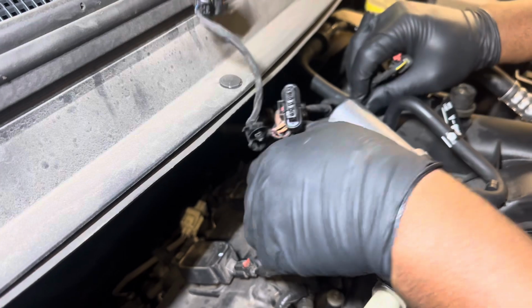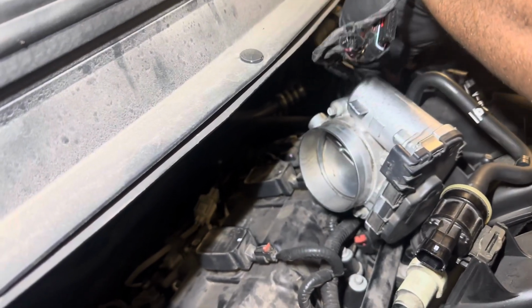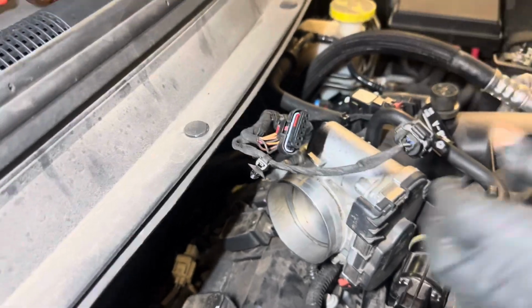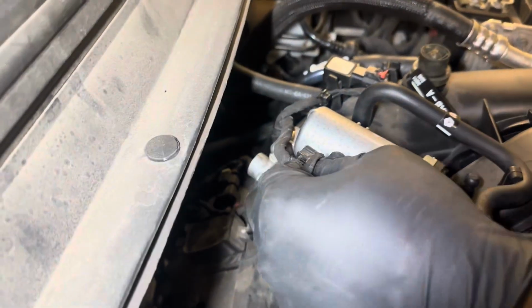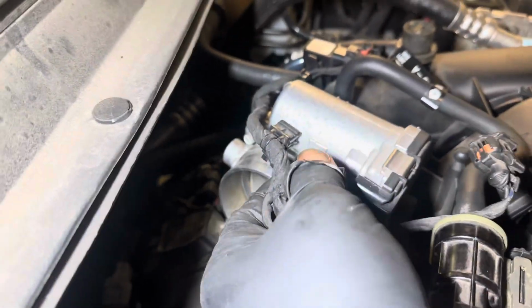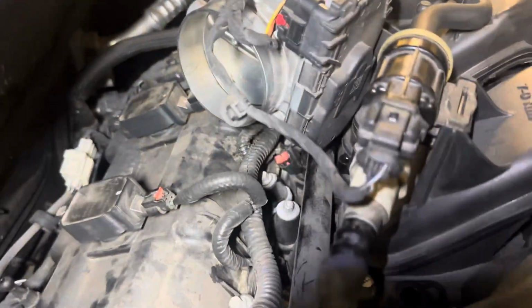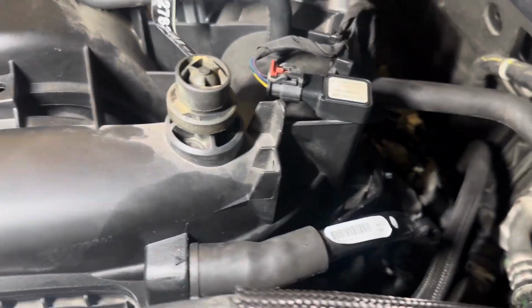Okay, the wire harness that you took off for your throttle body, we're gonna show you where everything clips in. So your first black one goes there. Then you have the holder clip go there, sensor clip there, and then you're left with that last one that goes to the purge valve. Now this hose connects there.